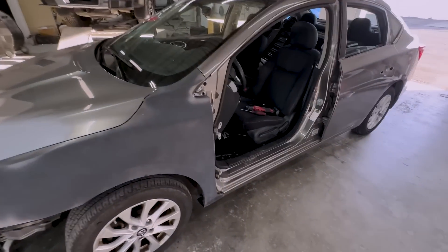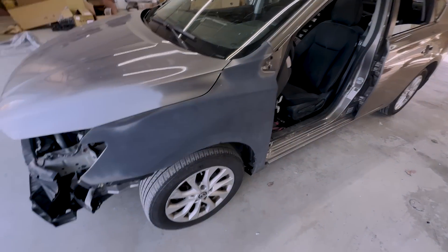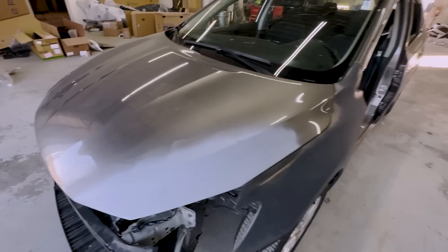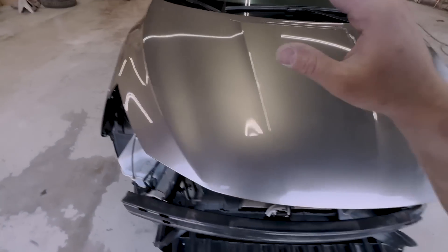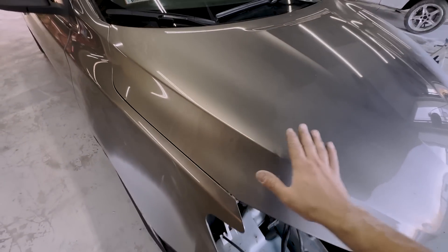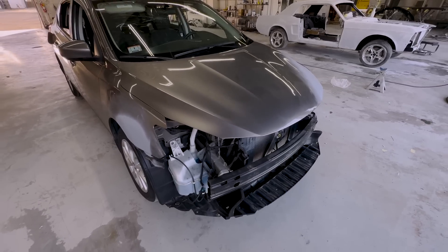We're going to pull it up right here, get everything else sanded, and then tomorrow I can put this door on, sand the door, and the whole car will be ready for paint. I'm going to sand this all with a 600 and then everything that I'm blending I'll sand with an 800. I'm going to use a DA because it's pretty quick, and once I'm done with the DA I'll just go over everything with a Scotch Brite pad. You do have to stay away from your edges so you don't sand through. We're going to go ahead and knock this out real quick so we're not here too late.